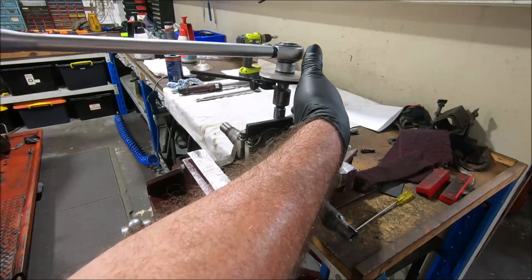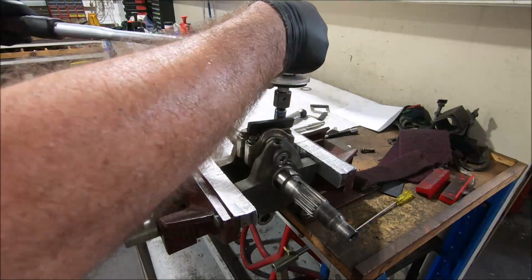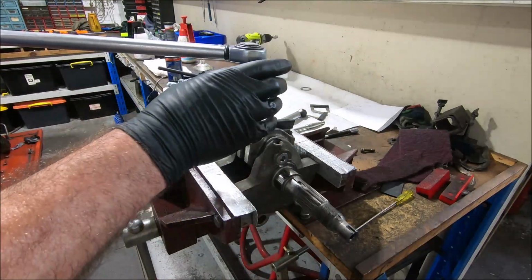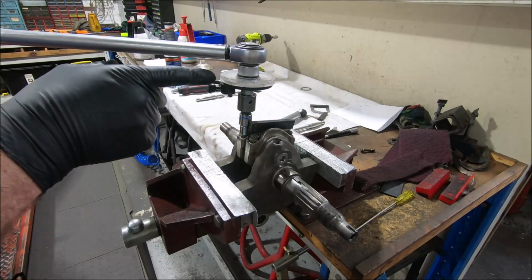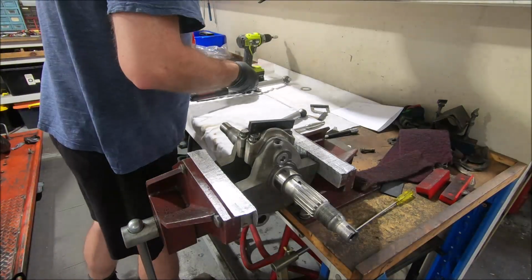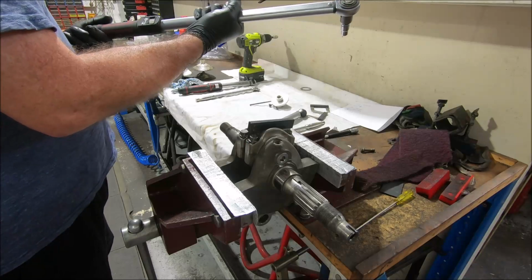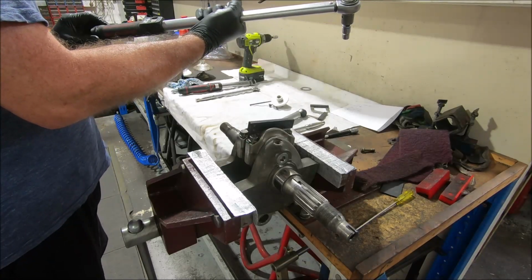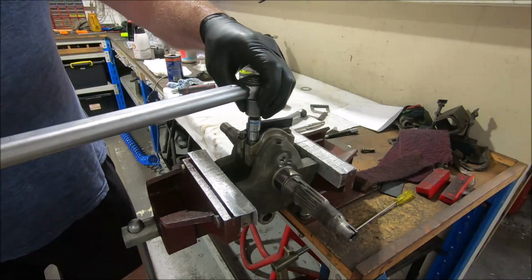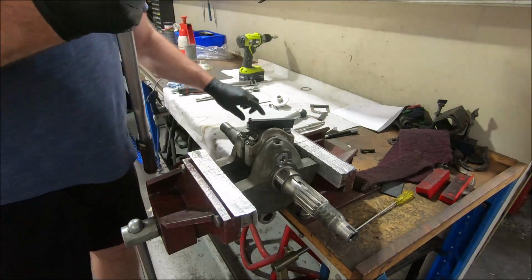And the torque wrench isn't clicking, which is good. That means we're not hitting 103. When it's done, I'll just make sure that they've all got 70 on them. If they've all got 70 on them, then they're fine. There we go. So they're all 30 backed off, 20, 35 and 65 degrees. And if I set this to 70 Newton meters, it should click. There we go. So they're all between 70 and 103.